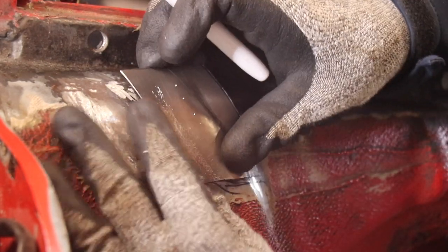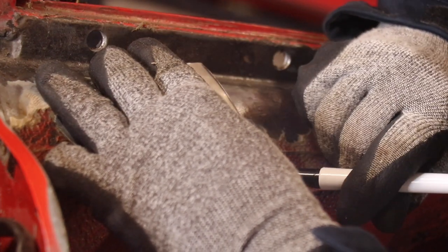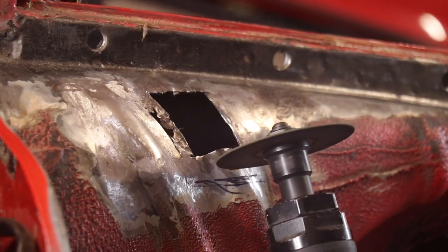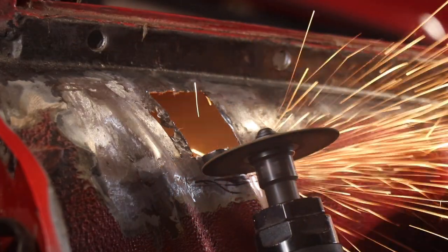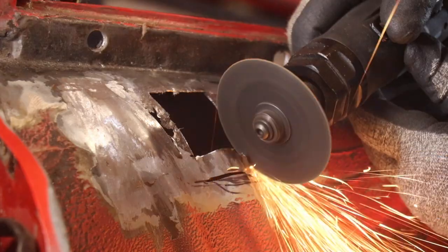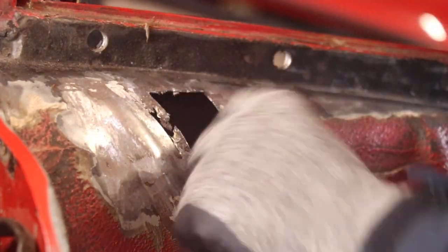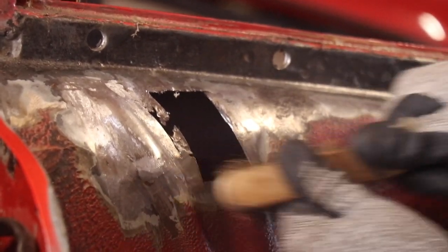When I look at my personal success statistics, I notice that cutting is the one thing that goes wrong far too often. I've therefore developed a strategy to first mark the rough shape of the repair panel and promise myself to do nothing that would come anywhere close to this line. Then I start trimming the opening step by step till the repair panel lies flat on the original surface. Then, finally, I remove all so-far markings and do the final cut.